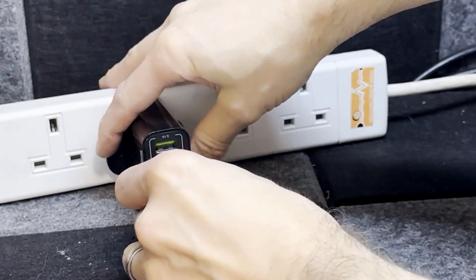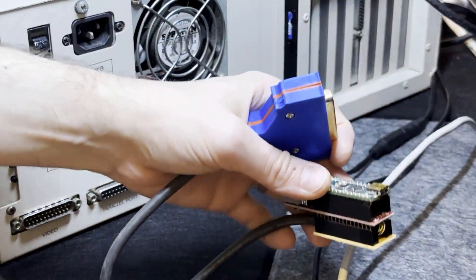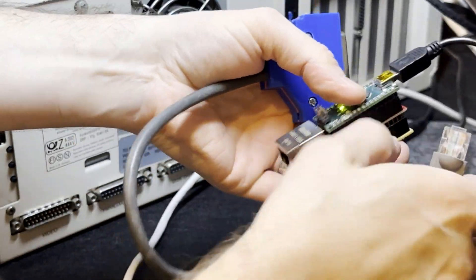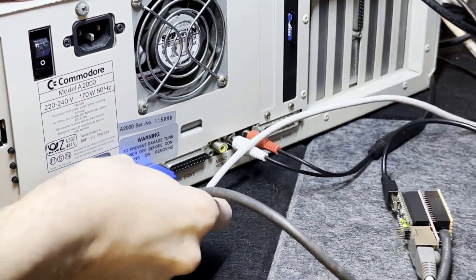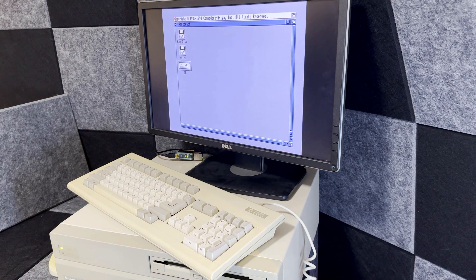The first thing I'm going to do is use this USB power supply to power the Arduino. I recommend powering up the Arduino first before connecting the Ethernet cable or the Amiga. It's possible to corrupt the program on the Arduino by power coming in via its GPIO pins — a weird one I know, but it really can happen occasionally. With it connected up, I'll power up the Amiga.